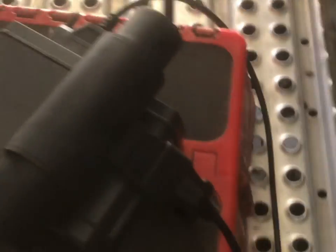So I'm going to go to the plug now, take the back off, and do a visual inspection on that. Right, so the next step is a visual inspection of the Susie and this plug. But now, we've had the tester on that plug and the wagon, and that's checked out fine. So, next step is to go into there. Now, this is our shunter wagon, not the original wagon that was connected when the fault first came on. Which would suggest that our unit is fine. But, got to be certain.